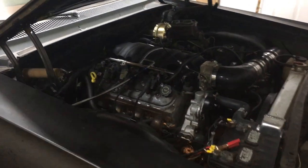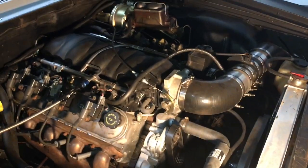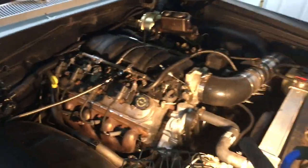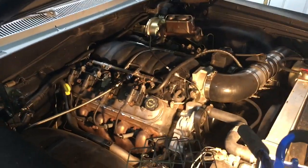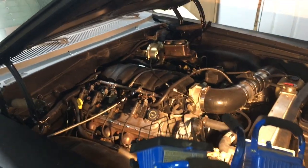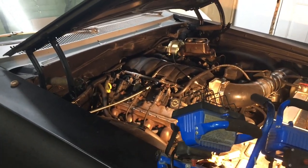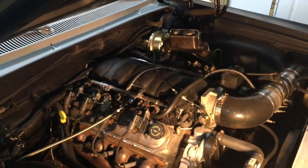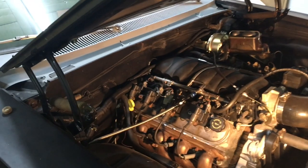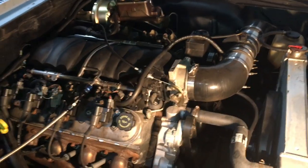For the clutch and flywheel, I just used a generic 11-inch clutch that I think went to a Chevy truck or something — nothing special. It's basically the same clutch used in Chevy trucks, GMC trucks, Corvettes, Camaros, Chevelles — pretty much all the GM muscle cars from the '60s and '70s. It's just a typical 11-inch clutch. The flywheel is part number FWG-460535, and I got that from a company online. I'll put all these part numbers in the description. I also got ARP flywheel bolts to make sure that's all good.